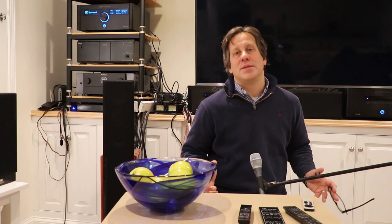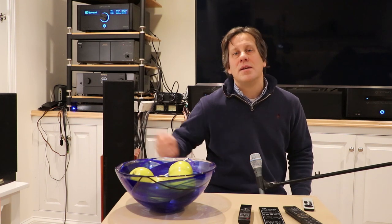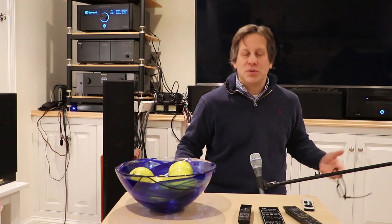So those are your options. If you want to use this workaround while transitioning from your receiver to your processor, you may have to try a multitude of different things. Make sure you have good HDMI cables. You may have to power everything down to the unplugged state — really unplug from the wall, give it a few seconds, plug back in. After making your settings and putting all cables in place, give it a try. If that doesn't work, swap the order: instead of going from processor to receiver, go from receiver to processor. Or try the ARC/eARC method. In each case, re-power everything down and back up, making sure you have the right settings.